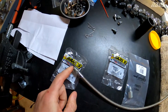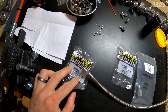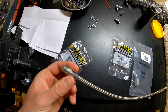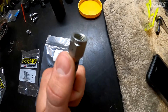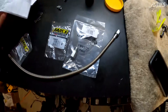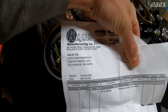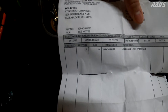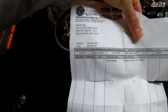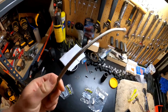That male fitting is going to thread into the one adapter coming off the block. So all there will be is one adapter off the block, then right into a clutch line. The clutch line goes all the way to the other end, which has a size-4 AN fitting — a specialty make-to-order part. The part number is shown on screen for Kaiser Manufacturing. It came in pretty quick from Summit — braided stainless.